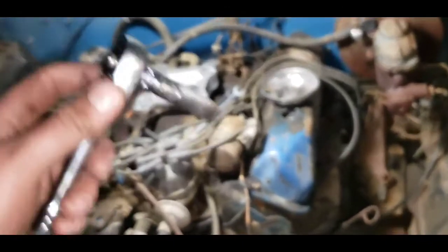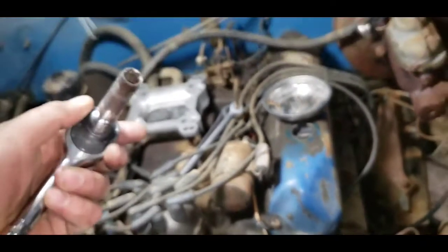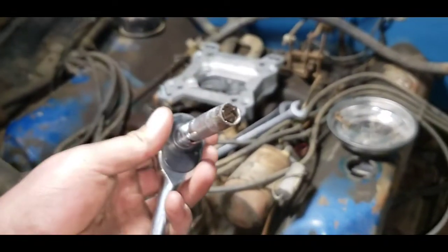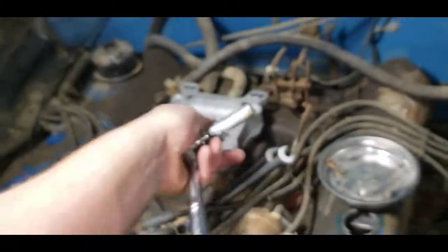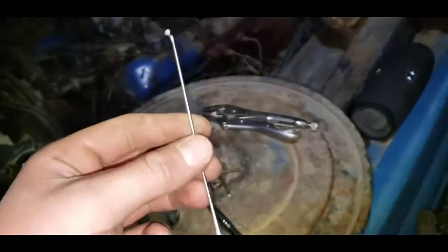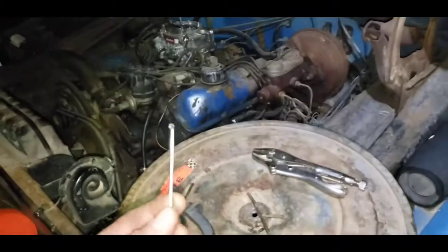Got her fitting just cherry enough so she'd slide down in there, because, you know, not super mint, so she's mint now. We had to taper it because where it was at the bottom, that hole, since we used a drill bit, they're tapered at basically like a 45, so we had to cone this out a little bit to get those bolts all the way tight, but that's not going anywhere. She's gonna be cherry.